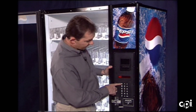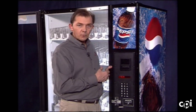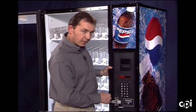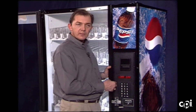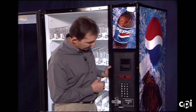Next feature in test mode is test vend. Enter by pressing star — it asks for the item. If there's been a problem with B9 and I did some work on it, I can select B9 and it will fire that solenoid, activating that gate to confirm it's functioning properly — same for any selection pressed. Clear errors is the next prompt — after you've listed errors, checked them, and fixed any problems, press star to clear those error codes; it confirms with OK and returns to the test mode prompt. That concludes all items in the test mode feature.